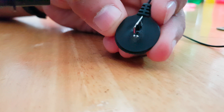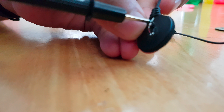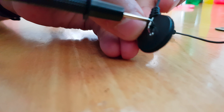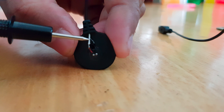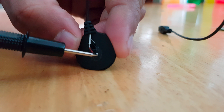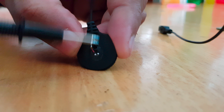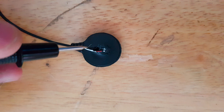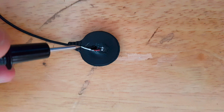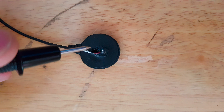Let me get a proper close-up for you. You can see the positive wire — it's soldered neatly and clean. But the negative wire is actually cut; it's not soldered to the connection point. What we need to do is connect that lead all the way down to the soldering point so that power flows to the mic. Here's a much clearer shot of the missing wire — that's the strand I need to connect.